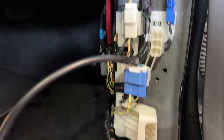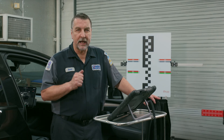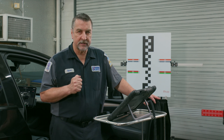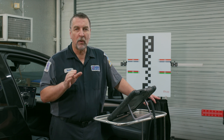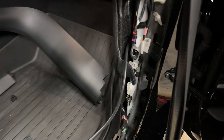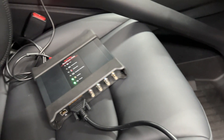You just follow the instructions and pull up the seal plate and open it up. You'll find what Tesla calls connector 179, which gets you on the vehicle CAN bus. It is a blue connector — highly visible on the Model 3, but on the Model Y the connector is white and tucked away. You'll need to pull the carpet out to get your cable in there.